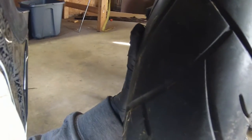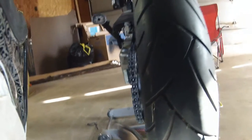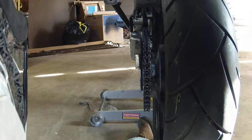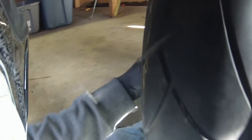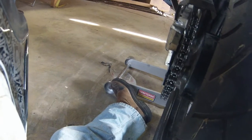The most important alignment characteristic on the rear wheel is the chain side — you want that chain to be completely straight. It's a chain, it can't handle a lot of variation. If you're off, it'll put undue wear and tear on your chain and sprockets and could do other damage. I put the axle in and measured the inside lip — it was about six and a half — with a gap of about half a mil to a mil, so I came out to roughly seven mils that I was going to need.